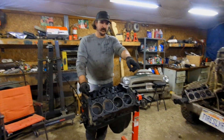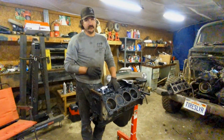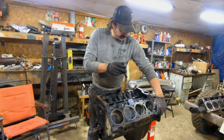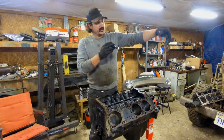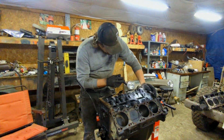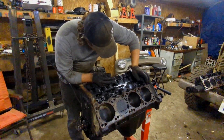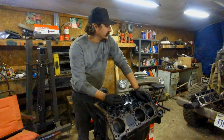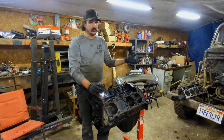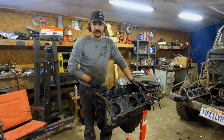That's the junkyard motor that needs cam bearings. This is the OG motor from the 51 — the very first one we put in. I was running these Felpro aftermarket head gaskets that are not MLS, and yeah, eight pounds — that's all they're good for. When it did that it took out the bottom end. We tore it down quickly and basically the cam bearings all look good except for one, which has a nice chunk out of it just like the other motor. The cam looks perfect but those bearings look really bad — this one just has one bad spot. I think we're still going to flip this one over and see what the bottom end looks like.